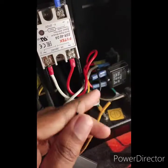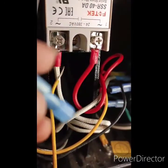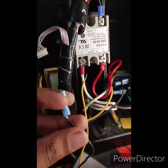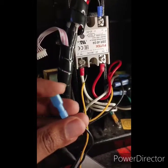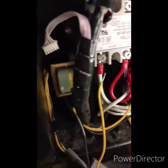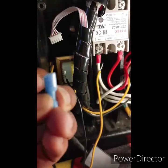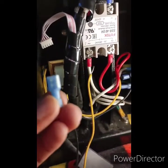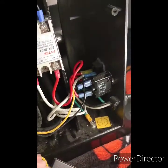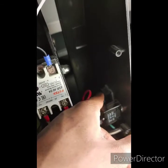Take your white and black wires and wrap them together. Then take a new crimp tip and place both wires inside. Once they're in snug — they don't have to be jammed in, just enough to reach the middle basin — take your flathead pliers and squeeze right there to secure both wires in. Then repeat that same step with the red and yellow wires on your new transformer. Once done for both pairs, just slide them right back into place.